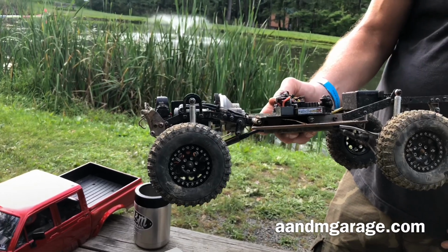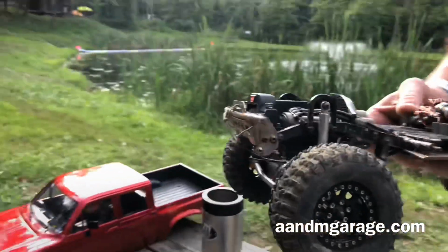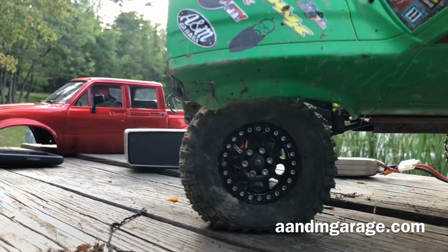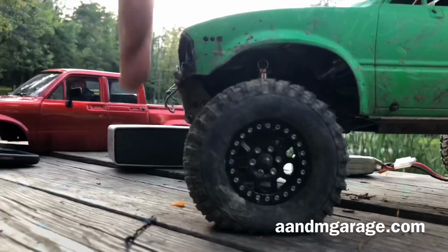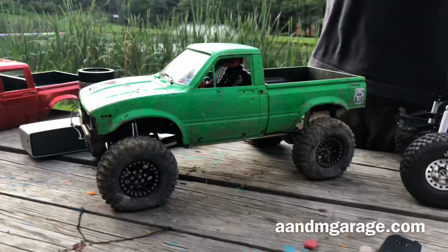When you said that the axle is a little bit forward too, right? Yeah. So that's going to get your front tire almost even with the front bumper. So when you're approaching onto a rock, what we do is we try to get as aggressive as we can, so your approach angle is right there. That is amazing. So you know, we don't like to have a big bumper hanging off the front of it. We really like to be able to drive up to something and have the tires hit it.